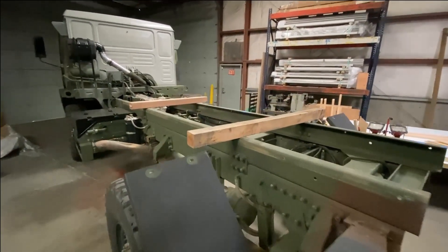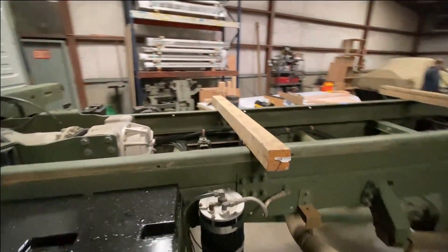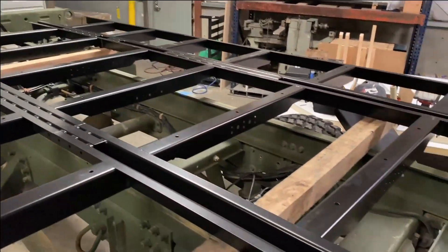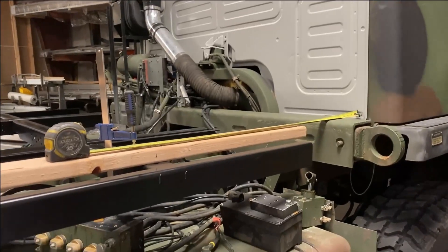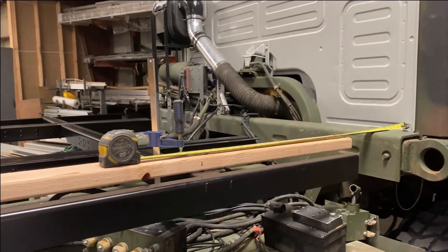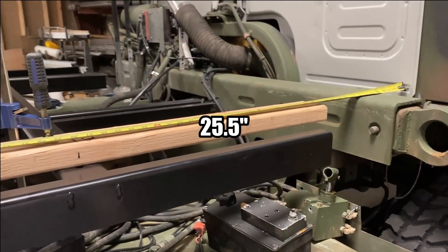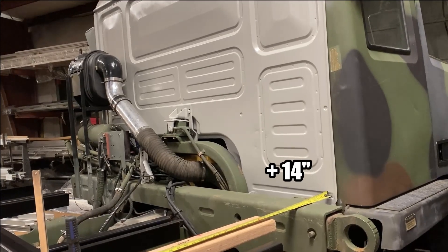Prep the frame of the vehicle by placing at least two 4x4 posts long enough to span the frame — use the posts as temporary shoring material to rest the subframe on for positioning. With the aid of a few friends, lift the subframe chest high and position it on top of the 4x4 posts roughly where you want it attached. Locate the front of the subframe with the rear of the cab, keeping in mind the positioning of the habitat. The 2x4 gives a visual reference of the habitat position, measured 25.5 inches from the forward-most center cross member.